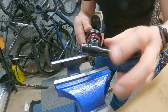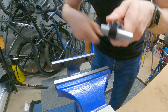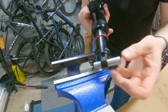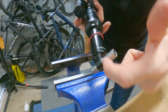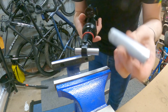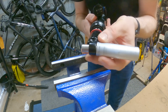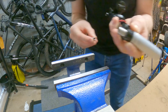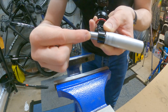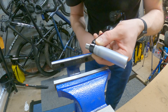On my particular shock these spacers just slide off and you can take those off with your hand. However, to get the air can off we've got to take out this metal pipework which goes through the bushing of the shock, and we're going to do that by pressing it out. If I put my hollow pipe in the vise and put it over this end, then I get my small socket - the socket will catch on this side - and the plan is to use the vise to push this through. It will go through the pipe and come out of the shock.